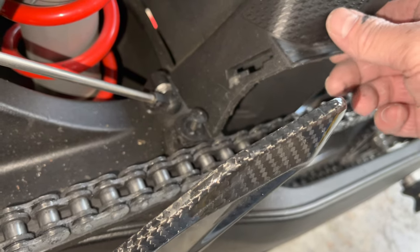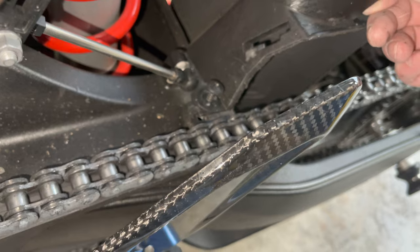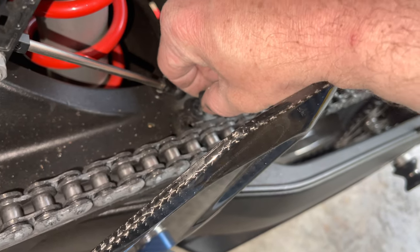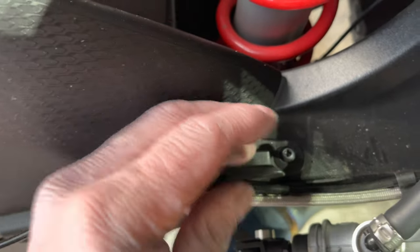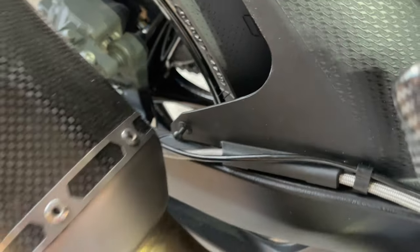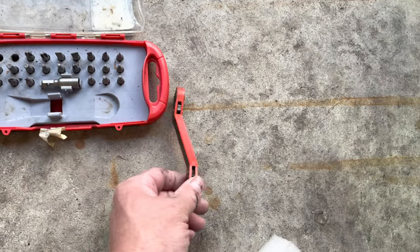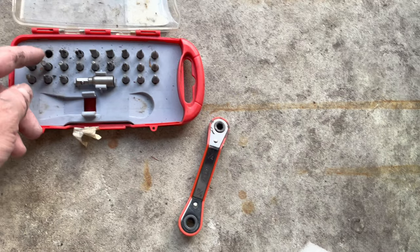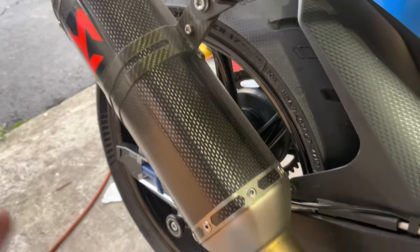I did get this out enough so I could just pull it out. Obviously you need to take this piece out and put it into your new piece. I was actually able to get in here without taking off the muffler — the only reason was because I have a flexible extension where I could put a little Phillips head in there and there was just enough room to get in between. If you don't have something like that you will have to take off your slip-on muffler.